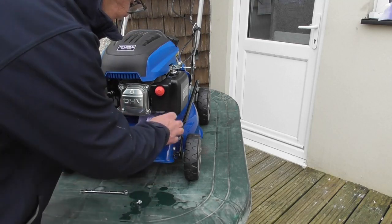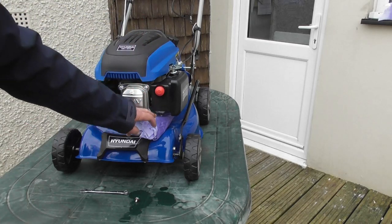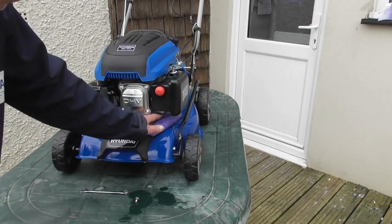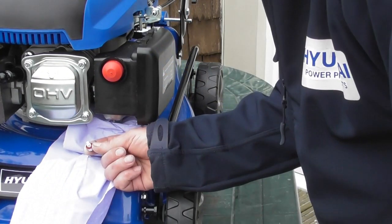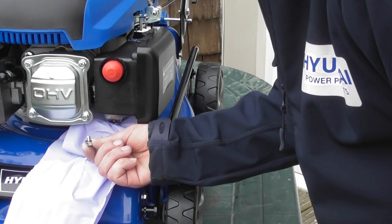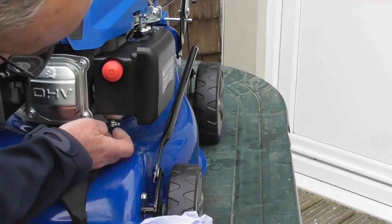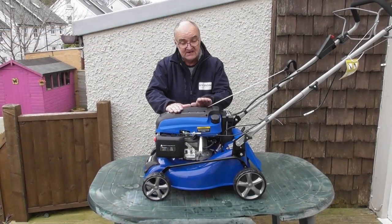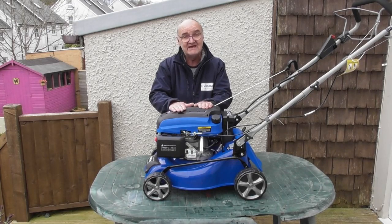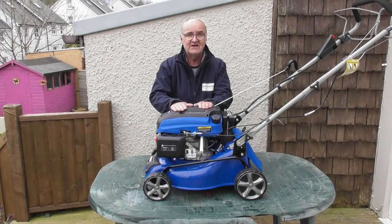Because we've only just drained the fuel tank, the carburetor bowl will have filled up again with stale fuel after we drained it the first time, so we just need to remove the rest of the fuel from the carb. I'll leave the drain open for a couple of minutes so that any residual fuel in the tank will come out and drain down to the lowest point. Make sure you don't lose the little red washer on the underside of the plug — that helps it seal when you put it back in. Put the drain plug back in and tighten it. Having completely drained the fuel system, it's quite possible that if you refill it with fresh unleaded petrol the lawnmower may come back — but not always. Some damage may have been done to the inside of the carburetor, so we're going to take it apart, repair any damage, and/or replace the carburetor.